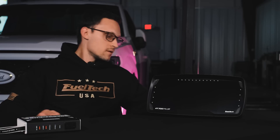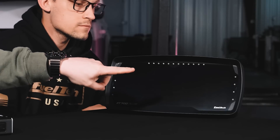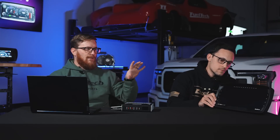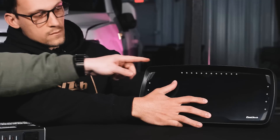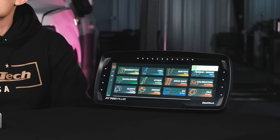Just remember, this works for the 7-inch and also the 12-inch, so the process will be the same — all the connection stuff works for either model. The USB port on the front corner is there for you to physically connect with a cable if you want to. We added that because the new ECUs have a bezel — a little eyebrow — that comes off and you can flush mount it into your dashboard. Reaching behind the dash to plug things in is a pain, so we made it easier. All communication when doing a cable connection will be done through that front port, not the back one.